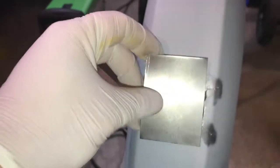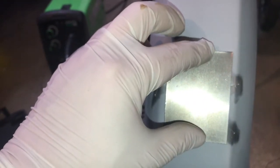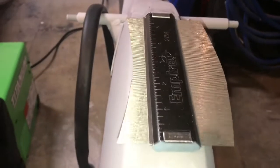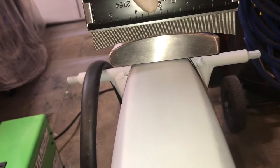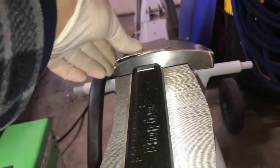I've already cut the metal that's going to replace this section. Once I get it shaped into the right curve, I'm going to use it as a template to mark and cut the area out, so hopefully it will fit exactly in the cutout with less filling and welding to do. That curvature matches the fender, and the dolly that came with my hammer-and-dolly kit is pretty much the same curve — I'll be using that dolly to shape this piece of metal before transferring and welding it in place. That's the plan.